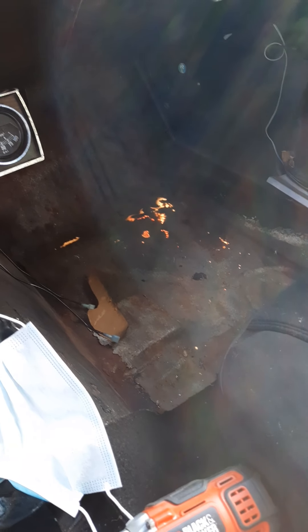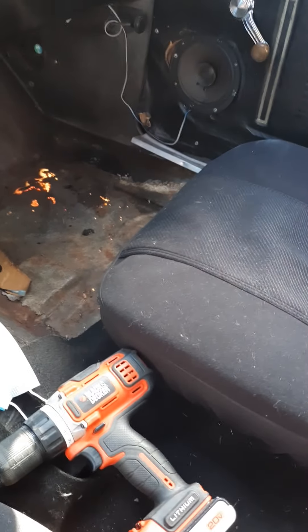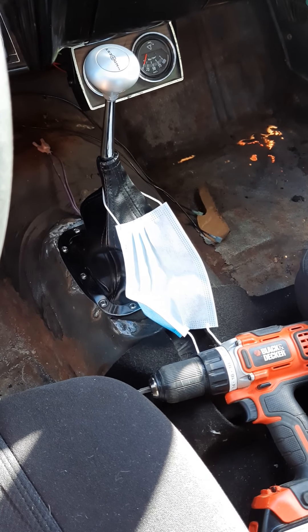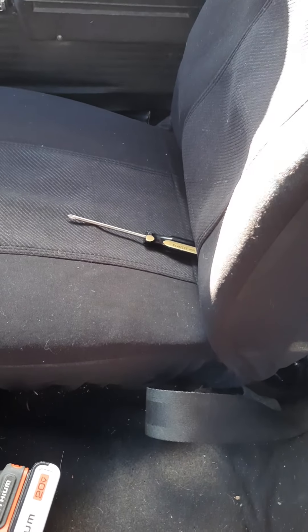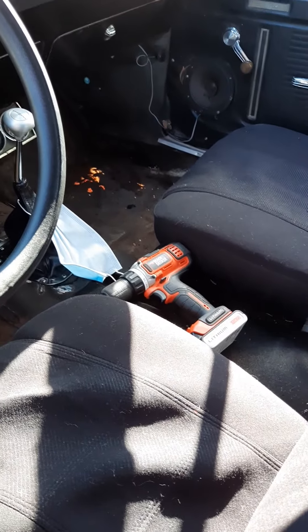You can see the floors have been redone with fiberglass. There are still holes on the passenger side. This was originally a bucket seat car with a 307 and a three-speed on the floor. We added the Lokar shifter just a few weeks ago, set up for an overdrive shifter, but the car still has the 350 Turbo. I have an overdrive — I just need to get it rebuilt and installed. The seats have cheap Dickies seat covers over early 1980s Chevy buckets — I think they came out of a Chevette. The nice thing is they recline; the originals do not.